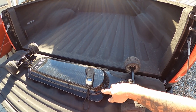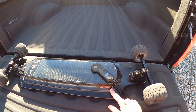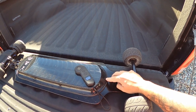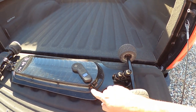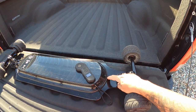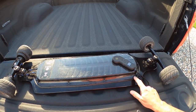When the board shipped, I was looking at all these screws — none of them have Loctite on them. If I would have taken these screws out individually, one by one, put some red Loctite on them, and put them back in, they would have stayed tight. Through 360 miles — that's what I have on the board now — I've been riding on the roughest stuff I can find: sidewalks, rough pavement, taking it off-road for my reviews. I think what happened is these screws started loosening up more and more. I never tightened them, never checked them. I think that added strain on the sockets that go into the board, and that's what caused it to fail.